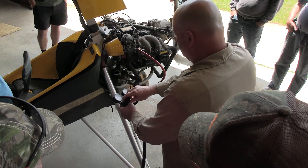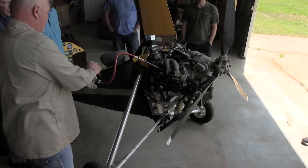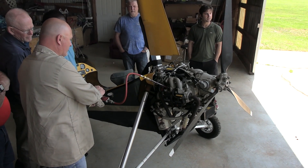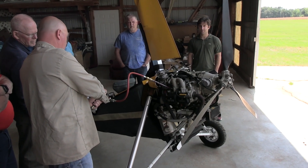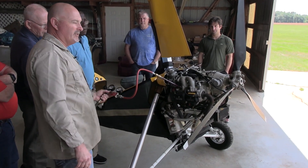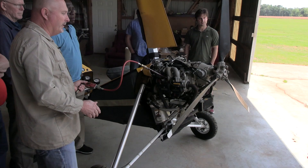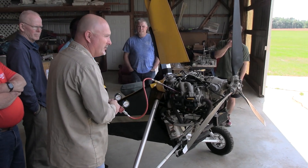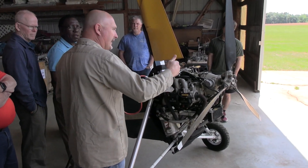We came up on pressure here, so now we're seeing 20/20. You feel the compression on it as you come up — you've got pressure on it and then it goes neutral. So now we're seeing 20/20 here. Let's see how close we are. Standing clear, Mr. John — coming up. We are at top dead center on compression stroke. We are showing 87 on this gauge — about a pound or two off — so showing 86 over 87.